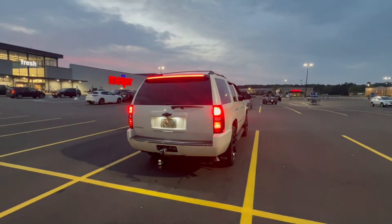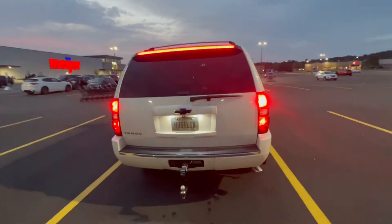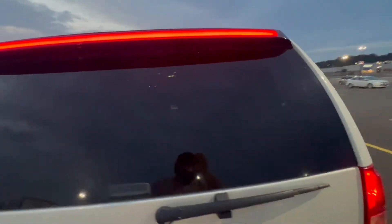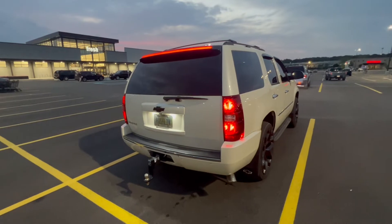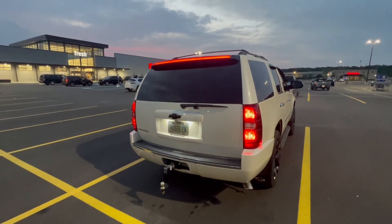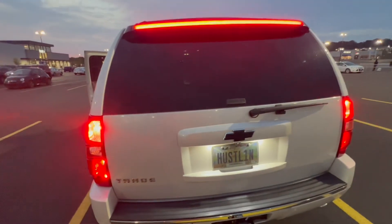Okay, so you can see she's hitting the brake light right now. Running. Brake. Running. Brake. Stop. So you can see that light now stays on about 50% — it matches the stock taillight. Still haven't got the other lights on, but go ahead and hit it. Brake. And the light goes full once you touch the brake. So yeah, pretty easy mod.